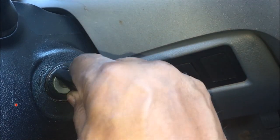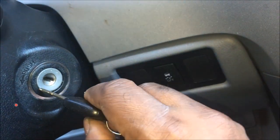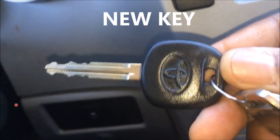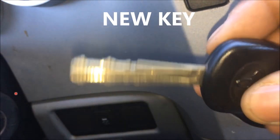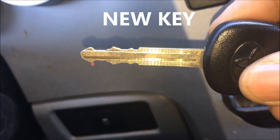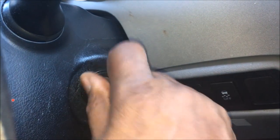Look, that key comes right out — that old key. So now I'm going to put the new key in. As you can see, it's square. It don't have that beveled in. And once I put the new key in and started it up, it locked itself in place. So before changing the ignition, try getting a new key made.